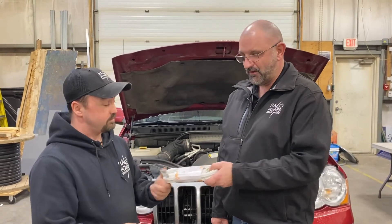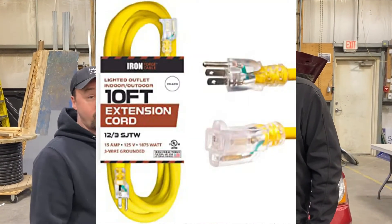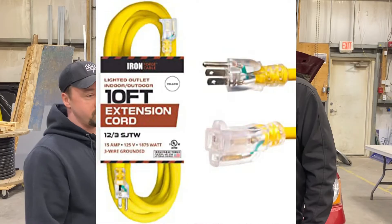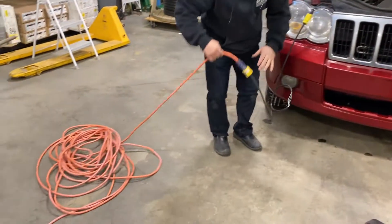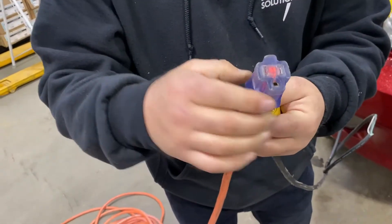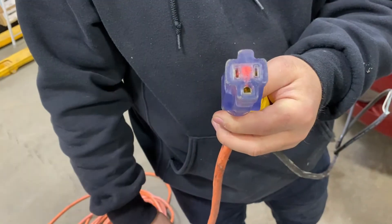So when you go to the big box store to buy a cord for your block heater, what should you look for? Ideally a 14-gauge, or to be on the safe side a 12-gauge, three-conductor cord — two prongs and a ground, so a three-prong extension cord. Most labels will say indoor/outdoor rated, but if it just says outdoor, that's absolutely fine. If you're using it indoors as well that works too.